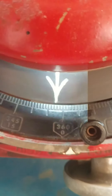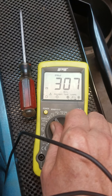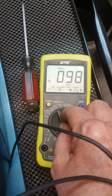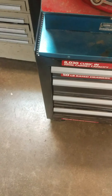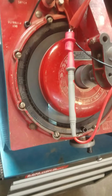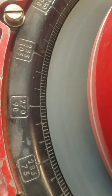Sure looks like about two degrees. Dwell is right on 30. We're at 100 RPM — let's see what kind of advance we got. Showing a little variation here, 98 RPM, so 98 times 4. You can see all eight cylinders even here. Looking at this cylinder, it's kind of hard to see, but it's showing about two degrees.